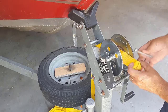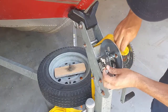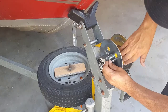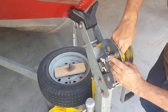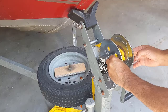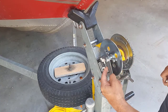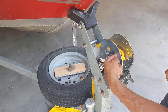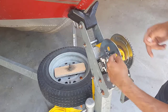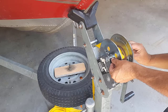We'll put the new strap in here and I'm going to run this bolt through the loop. Now the reason I'm doing this video is because I've seen someone else do this totally wrong — they ran the strap through one of these holes and then ran the bolt through, flattening out the strap. You shouldn't be running the strap through those holes at all. All you need to do is run it flat through here and run the bolt through the loop.